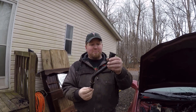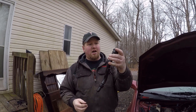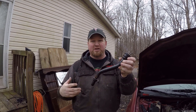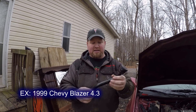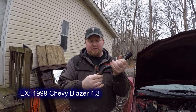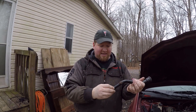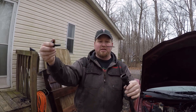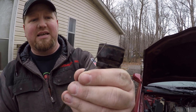This is a power steering reservoir extension which came stock on the 4.3-liter V6 cars like the Blazer and some others. All you're going to need to put one of these on your car is the neck itself, the little grommet that goes with it, and the cap which has a dipstick in it. Then you're going to need to cut the dipstick down a little, just so that it reads correctly.